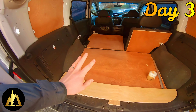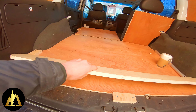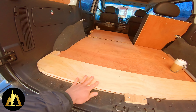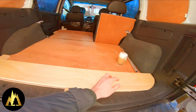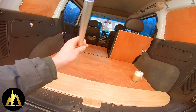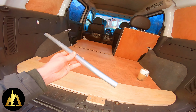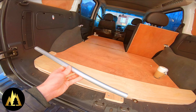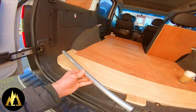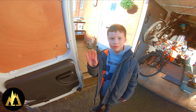Day three, it's a little bit warmer today, the sun's out. I've fitted this panel of wood here which is going to be removable, and the plan is to mount some fork mounts to this. I've bought this metal pipe which is 16mm internal diameter, so our 15mm axles should fit in there with tolerance. So I'm going to cut this to size and make some fork mounts so the front wheels come off and mount to the van. I've got my helper with me today — let's get building.